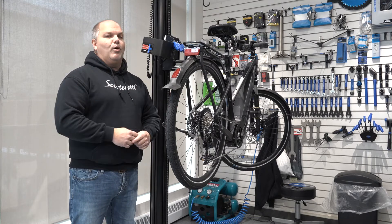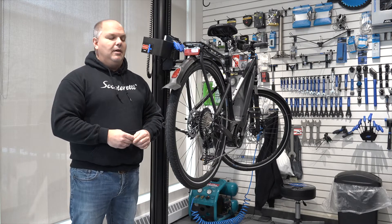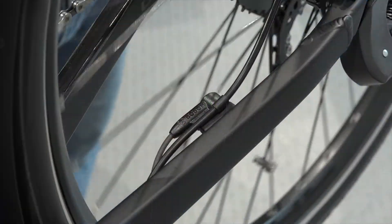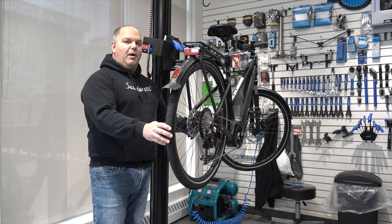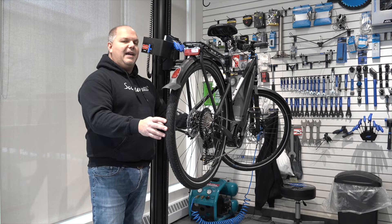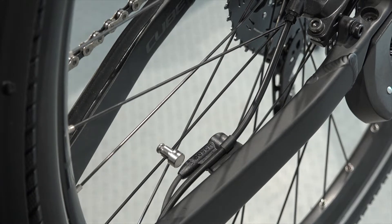Let's go back to the more normal common issues that may cause a 503, and that is placement of your magnet against the speed sensor. We have our magnet located right here on the spoke, and we want to make sure that magnet is properly aligned with the little line on the sensor. As you can see from the video, that little mark is where you want to be aligned — not where the rubber cap is that holds the screw of the sensor to the frame. Aligning that should be a cure to the problem.